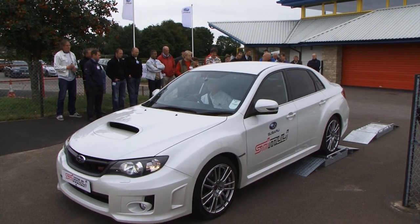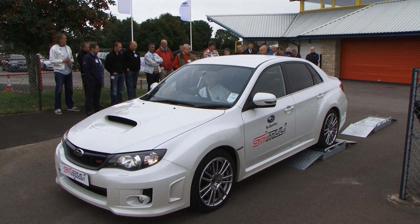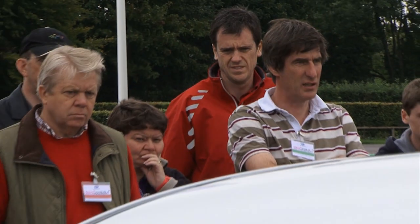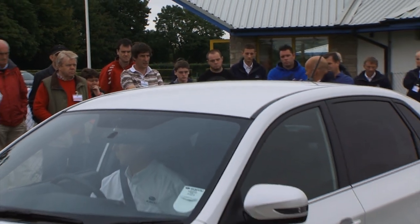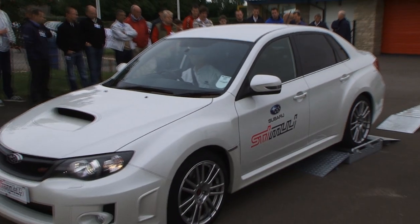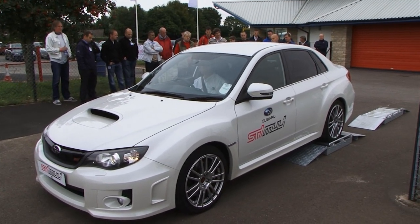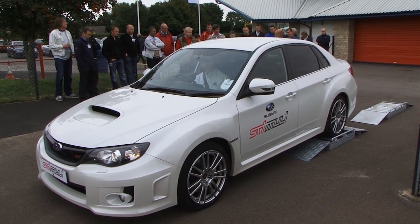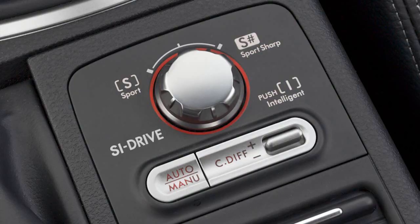So with the rollers, with the rear wheels in, we can demonstrate the difference between it being fully open centre diff, which gives us the 59% to the rear, to a fully locked centre diff for bad weather conditions or driving on gravel. The auto mode will do it itself — it will look where the distribution of the power needs to be. So what should now happen is the rear wheels will spin a little bit more than it would do if it was locked, because it's giving more power to the rear.